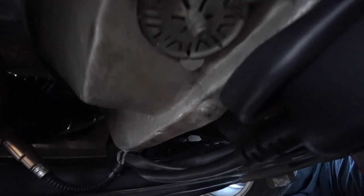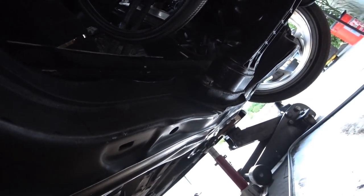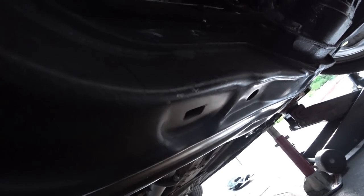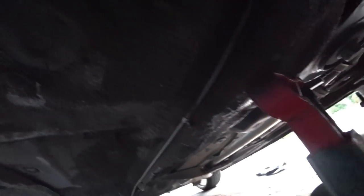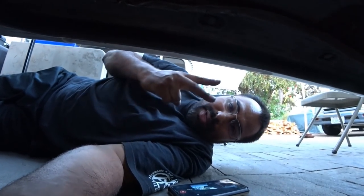You can see it's kind of hard to see but you'll see where it's routed. On the steering rack there are some zip ties — that's where we zip tied it to the power steering line underneath the heat shield. We also wrapped it with exhaust wrap for extra shielding. That's pretty much it — that's how we routed our AFR underneath the car. Sorry for the poor lighting but it's getting dark. That's how you route your boost gauge and your AFR, and that's how you wire everything up. Thanks for watching Pinchial's Garage — peace out and have a good one.